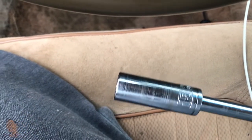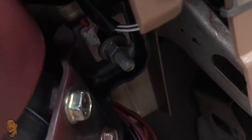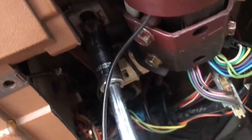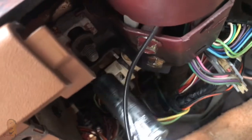First thing you're gonna need is a 15 millimeter wrench socket. Get up under here — you see those four bolts? Those are 13s. But you're gonna get to that bolt right there — that's a 15. And that's one right here. When you take these off, the steering column is gonna drop. So what I would do is break these loose, get them kinda low, and then pull those four bolts off. The dimmer switch is gonna be behind this right here. So take these two bolts off on the side first.